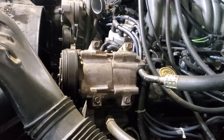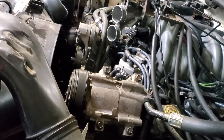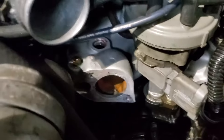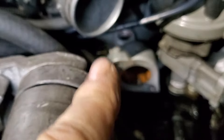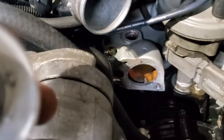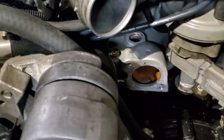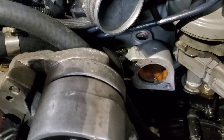A lot of these things, you're supposed to have a little air bleed made in the thermostat on these engines — some do, some don't. Well, I went to the local NAPA, and this one's supposed to have it. As you can see, there's something missing right there. The thermostat's good, it was a brand new thermostat, but NAPA didn't have one with the air bleed in it.